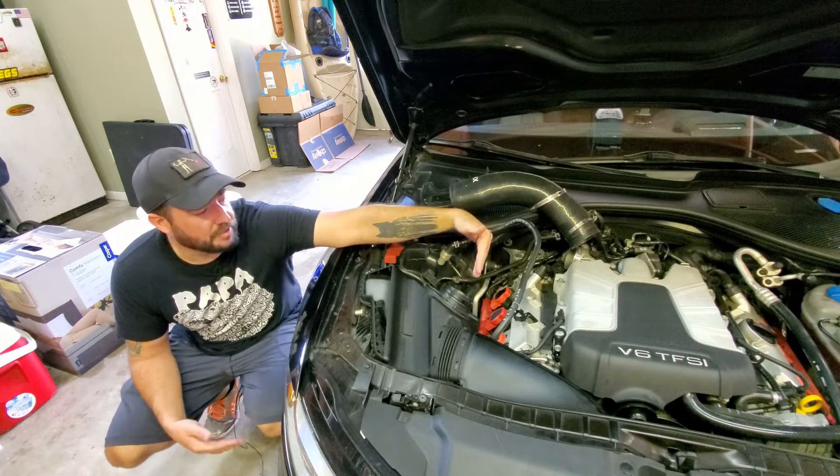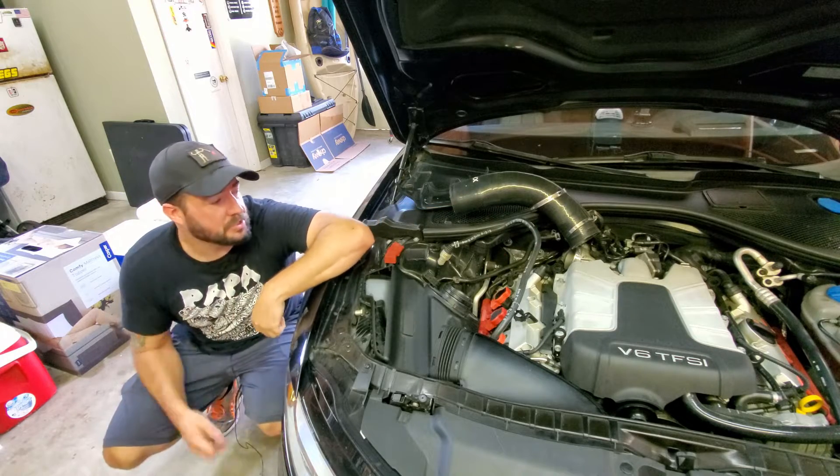I think that's what's going on with mine because I have a used intercooler core on the passenger side, but I'm going to do some diagnosing first before I tear that apart. Before anybody says something in the comments - yes, there are other things that can produce misfires, but they're not as common as these three. Other things include really bad valve cover gaskets leaking down into the spark plug wells and introducing oil into the combustion chamber. The other thing is potentially clogged OEM catalytic converters - as you accelerate, it will act as if you're getting a misfire due to too much back pressure, causing the car to go into EPC mode. If you scan for codes, it'll usually show a catalyst issue.